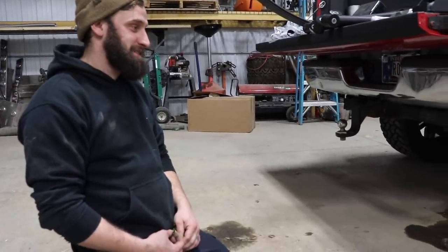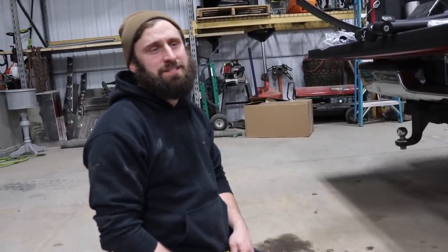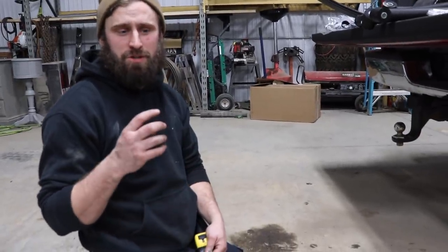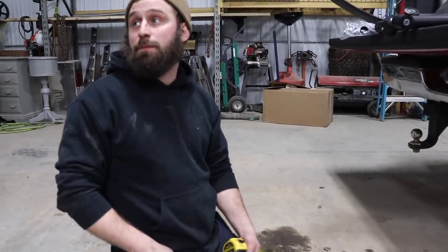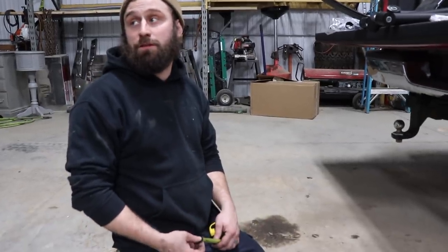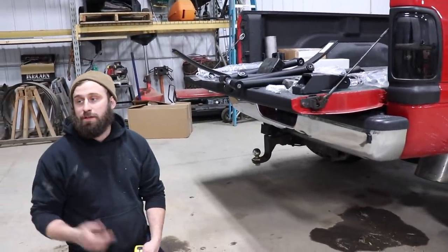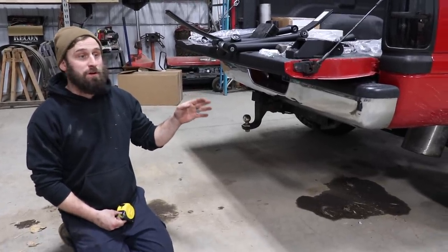I was wondering how it cleared these tires so well without hardly rubbing until you almost fully lock it. Apparently it's because it's already lifted. It doesn't look like an out-of-the-box lift — it looks more pieced together. The back has different blocks. Up front, you can buy a leveling coil that's bigger — like a one-inch coil — and then they put a two-inch block on the front to stack on top of the coil. But really, on a Dodge front end you should only get four inches max before you max out the upper arms.